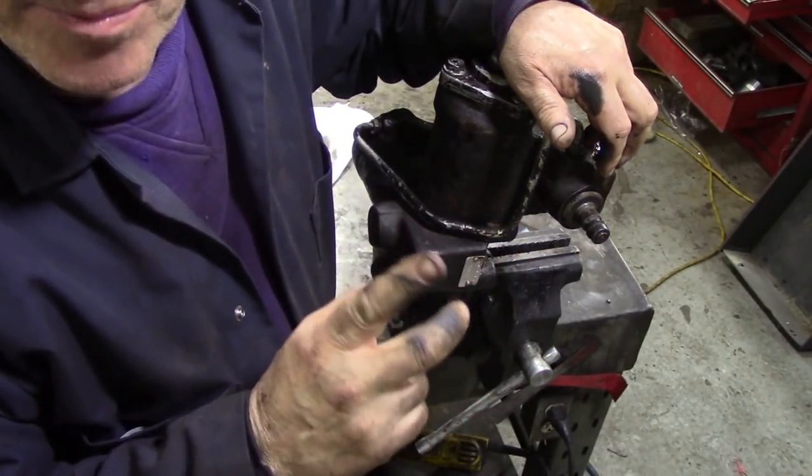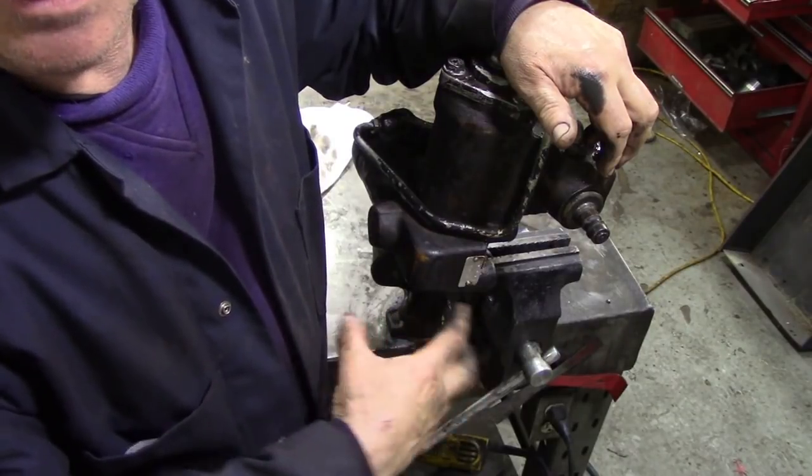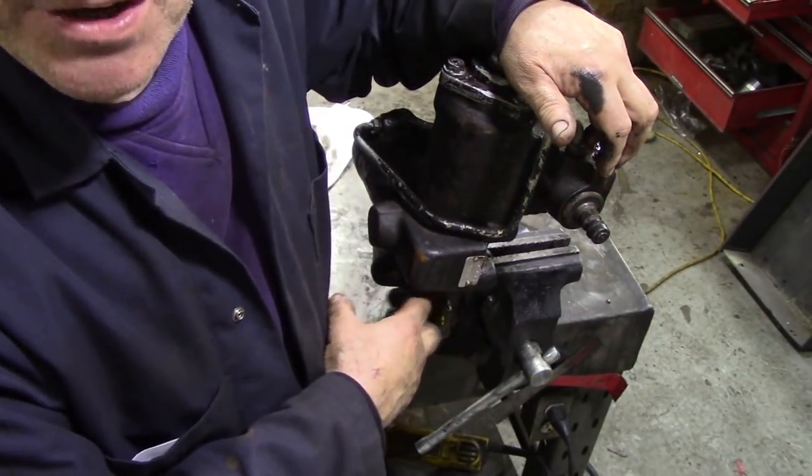And this is the problem, because usually the seal in the bottom, being a high pressure seal, and this turns only like a quarter of a turn, or a third of a turn, it'll gradually wear into that shaft, and you'll see that some of the shafts aren't salvageable because you can't put a sleeve on them. You can't really weld them up. You're not supposed to weld anything for steering, so that's out. Like I say, if you put a sleeve on, how are you going to get it in and out next time? Because it has to pass through some needle roller bearings, which is in here.